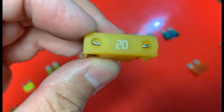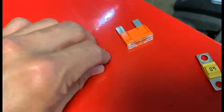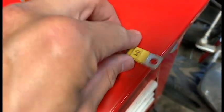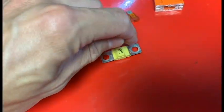There are little tabs at the top that you can touch to verify there's power going across. There's 30 amps, 40 amps. And then inside some pre-fuse boxes, we've got strap-style fuses that you can't really see if they're blown — you've got to check them. See if there's power on this side and power on this side, and I'll show you what I mean.